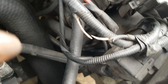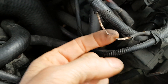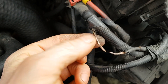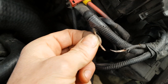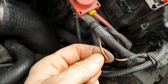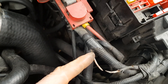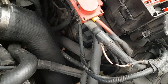After a little bit of exploration, the fusible wire is indeed fused — it has actually separated. But it's really hard to see because it's inside black rubber sheathing, so you can't physically see that it's blown until you feel around and notice a little gap. When you move them, you can feel that they're moving separately inside the rubber. Bit of a crap design — I can't see why they don't just put an inline 80 amp fuse there, because visibly you cannot see that it's blown.